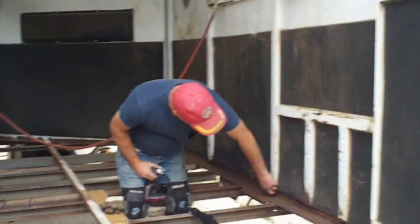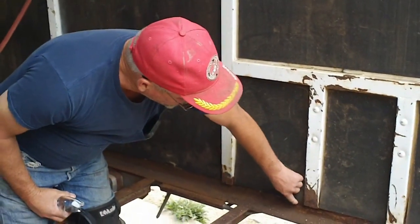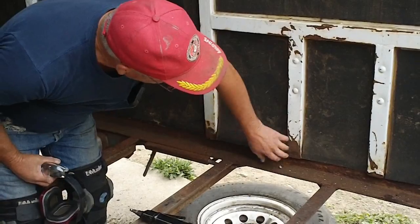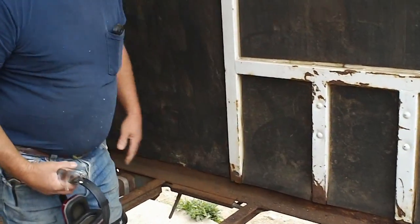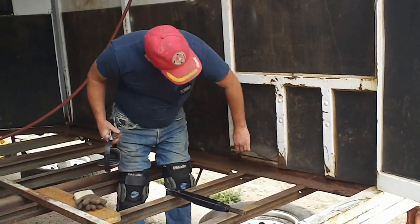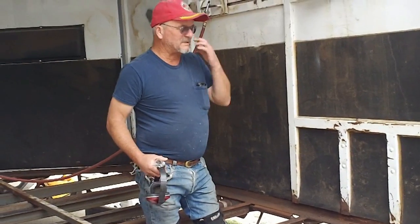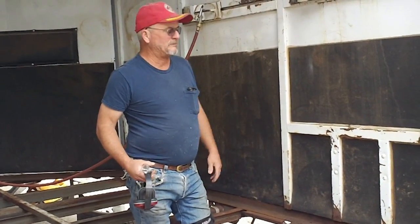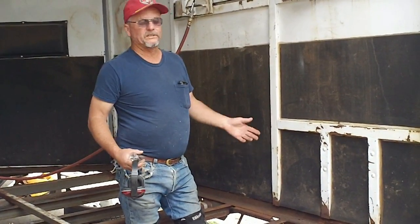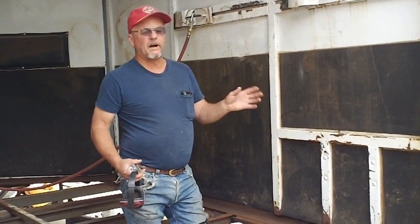On these, we'll get back to the framework. These are open-ended, but you can see the rust. So you want to treat the rust not only underneath the mats — you can see the heavy scale here — and then up along the sides would be a good idea to clean them up and take care of it at the same time. Pull the mats if you need to because they do get in the way, and put in a really good rust stop. Ace Hardware sells that. It's a good product — it's about a dollar a quart cheaper than the Rust-Oleum in can form. It works just as well. Use the primer, use the paint, same brand, so you don't have any conflict with chemistry.